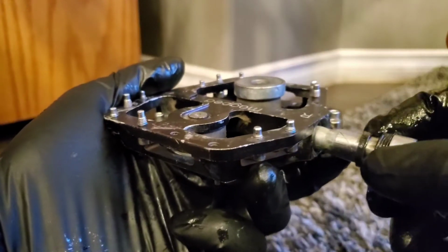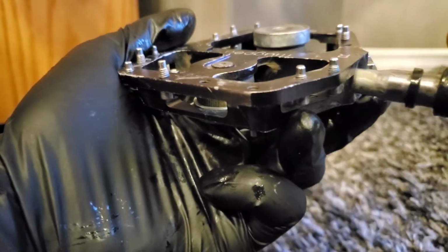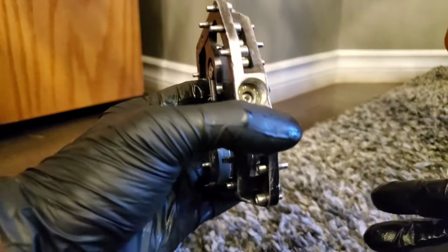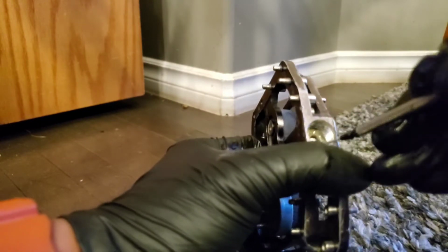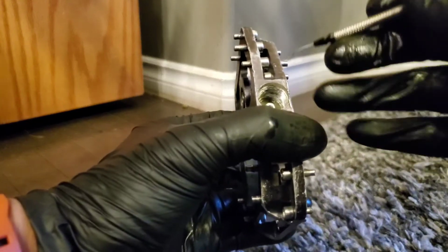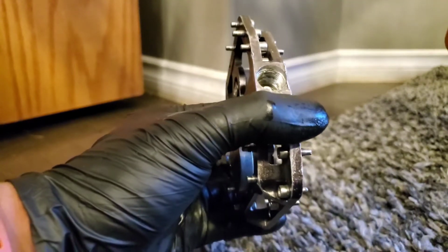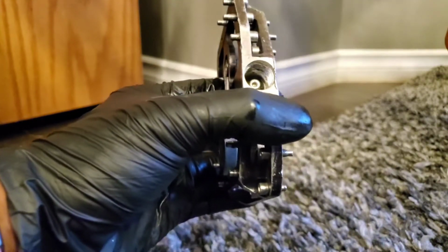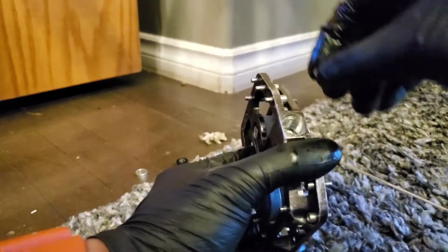So I'm just verifying my placement. The rubber grommet is placed around this way here on the crank side. The ball bearing goes on to this side here. So push it in a bit so the bearing itself sinks in. There you go. Then I just have to dry it up a little bit so the nut isn't greasy when I tighten it. Okay, so it's all clean. After that, we can put in the nut again.